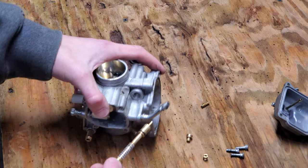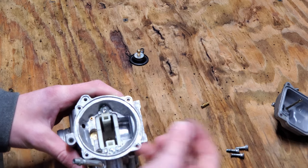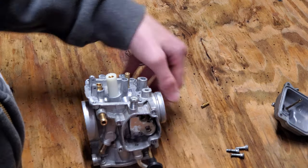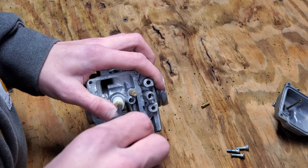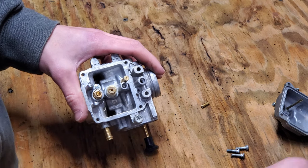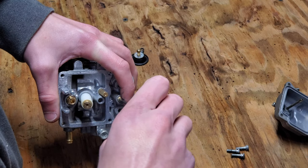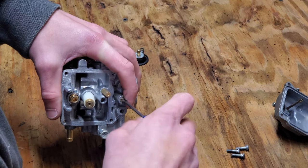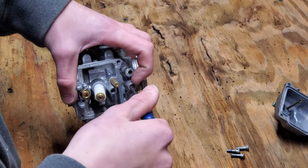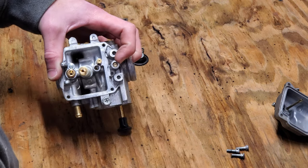Now that that's all clean I'm going to put this thing back together. First the choke — just like we took it out, slide it right back in. Now that that's in place we're going to put this jet back in — it goes right there just like that. Go ahead and put these jets back in underneath. Like I said before, just go in snug — you don't need it too tight. Next this jet. Next your idle adjustment — thread this all the way down until it's snug, just until it stops. Right there I could feel it all the way in, so now I'm going to go exactly two turns out: one half, one, one and a half, two. So that should be adjusted properly.